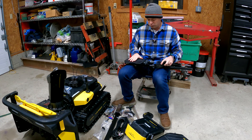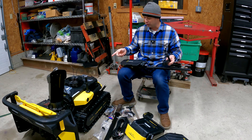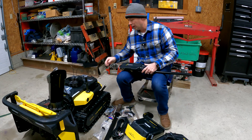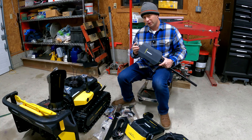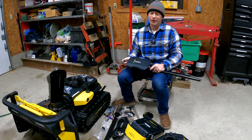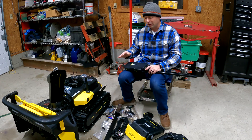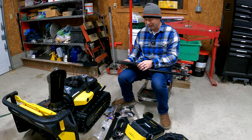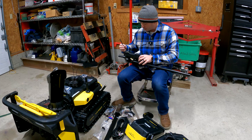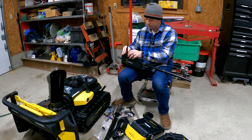It's a little different from past models that had direct power and used Wi-Fi to reach the home network — this one uses Ethernet. Let me screw in the antennas and get this installed. I'm going to put it on my playhouse since it has power out there. The Wi-Fi Halo is supposed to cover several hundred meters outdoors — I think around 200 meters in ideal conditions. Make sure you match the antennas to the correct labeled ports.